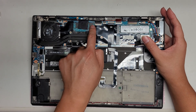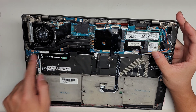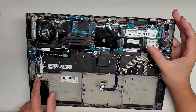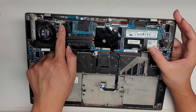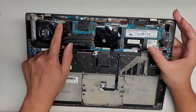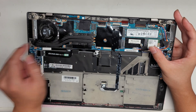The RAM is built into this board, so you can't upgrade it — these chips are the RAM. Then there's this small connector here, which I think is for the fingerprint sensor; it goes underneath and out. Then you've got the fan — the fan connector is here. To disconnect it, pop up these little latches, pull the cable out, and to put it back, push the cable in and push the latch back down. There's also a connector here that I'm not sure what it's for.